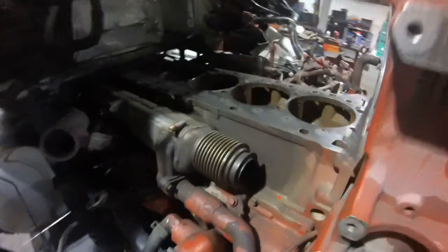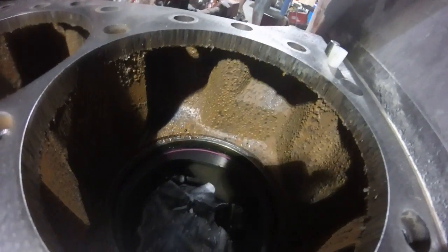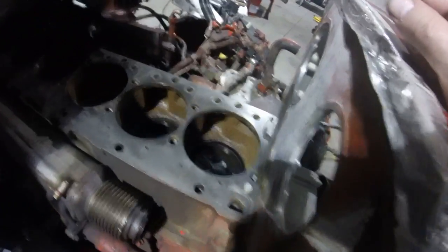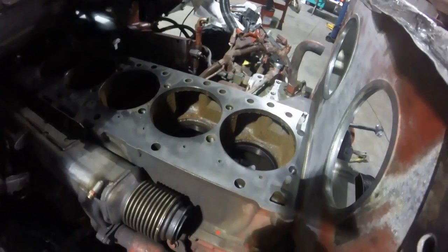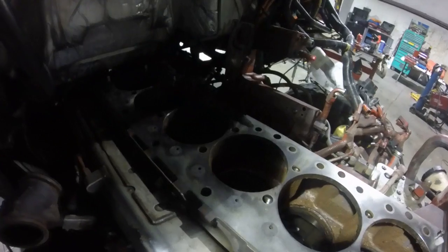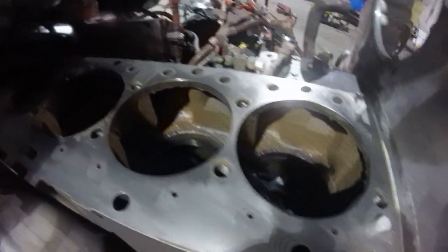With all the liners out you can clearly see that brown nasty waxy dried coolant substance has inundated the entire engine block. We're gonna have to clean all this out. The truck is made for work and making our living, so I'm just gonna clean this up as best I can and put new liners and a new head on it. The engine never had any overheating problems. I might buy a new oil cooler considering what I'm seeing, but I think I'll just try to clean and reuse it.